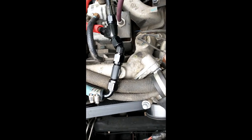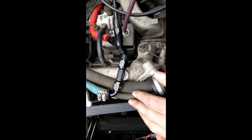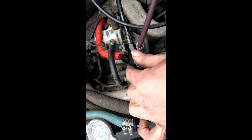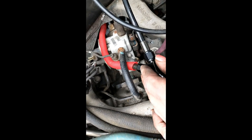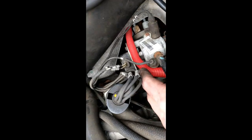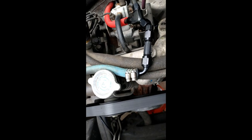Here's the angle I found best for the T to run at. I've got some heavy duty charging lines running here, which some might not have — this is a heavy communications package. There are pictures in the instructions that help you know where to go. I had the best luck inserting the lines from the engine bay towards the back; had to route them a few times to get them where I liked them. They were touching a few items — you may want to get some loom. I had some extra red loom, which worked out pretty good. You can get that anywhere, like O'Reilly's.